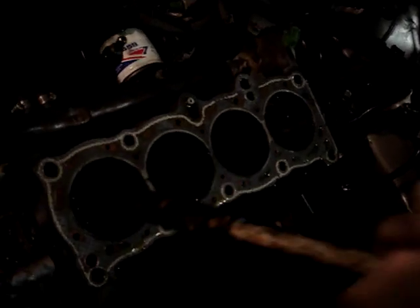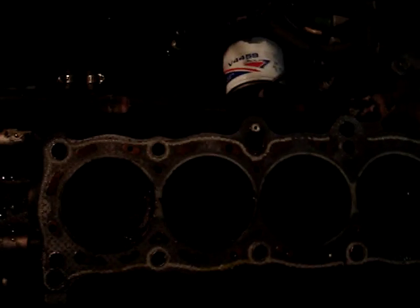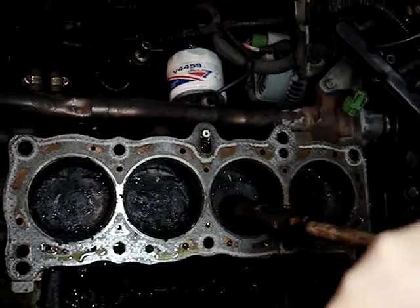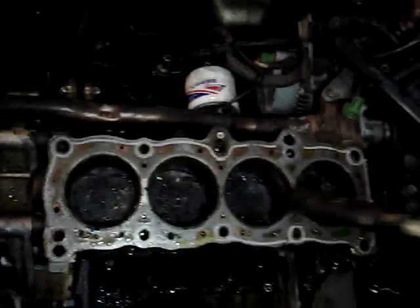Show the pistons. Normal up here, but listen when I push each side — it looks like I either snapped the crank or the mains are gone. Wow, this side's worse. Get the light and just look at these two right here. If you notice, these two aren't gonna move. And look at these two — it looks like it's the rods.